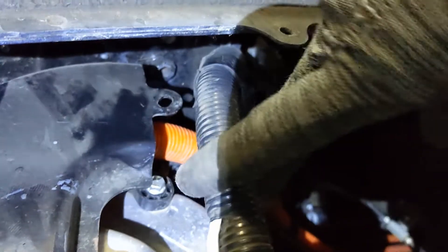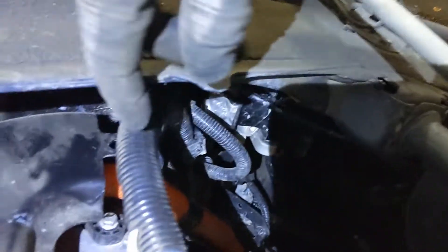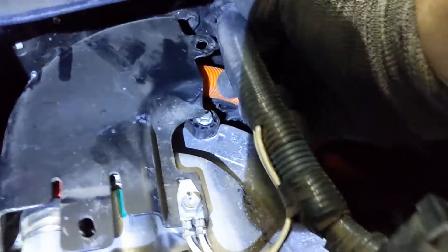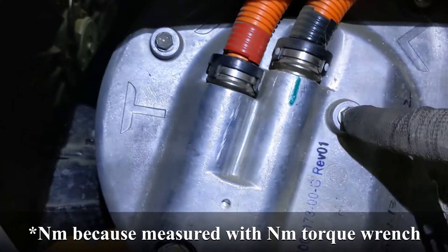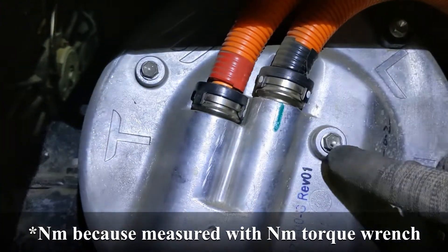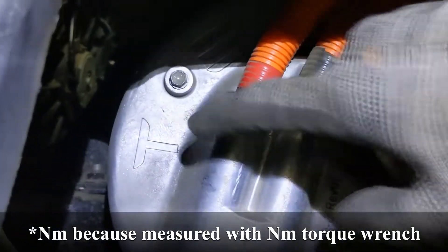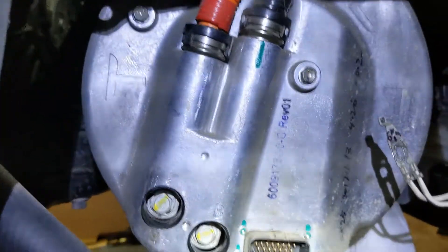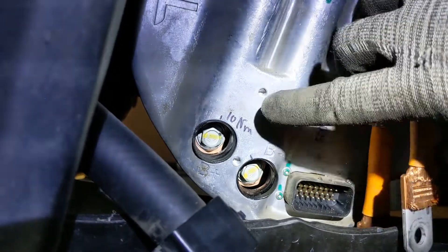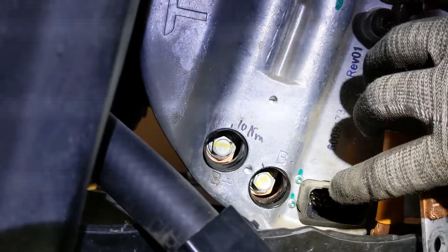Toyota already kind of damaged the connector between this wire harness and this bracket — it's also a snap fit connector. The bracket is off. This one was 6 newton meters torque, the nut up top was also 6 newton meters, and this one 12 newton meters. Next we remove these two bolts over here and pull these two cables out. The cables are out — 10 newton meters is the torque. I put the bolts back so I don't lose them.